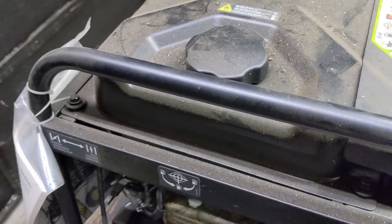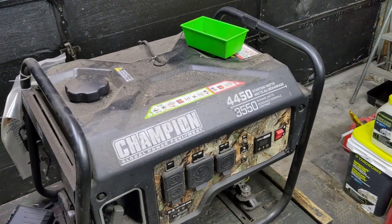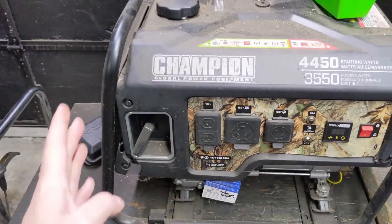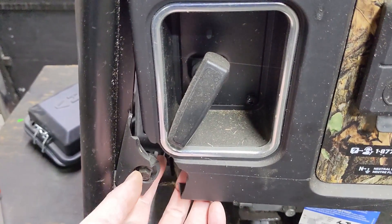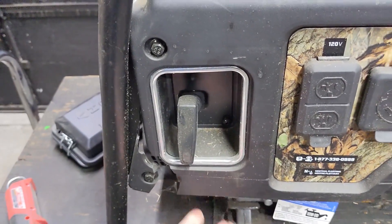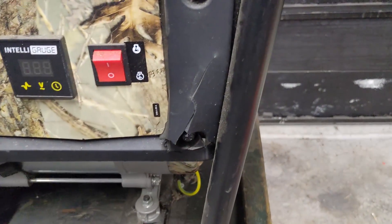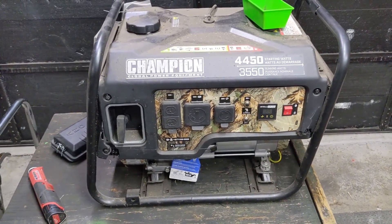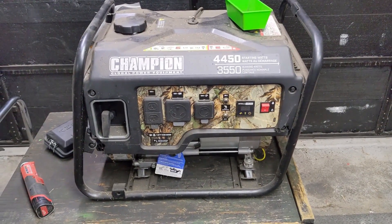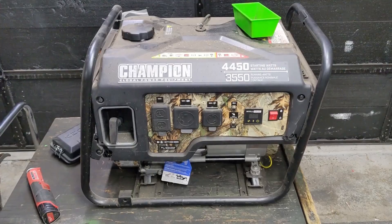The fuel tank is metal and connects to the upper frame via what I think is four or six bolts — the fuel tank itself is not damaged. However, this front plastic console has separated where the recoil handle box is, so when you pull it the whole thing moves, which isn't great. We can possibly look into replacing this plastic console; I could JB weld it with some bracing, but if I want to maximize profits on the sale, a replacement panel would be worth it.